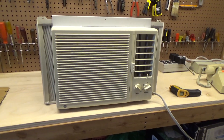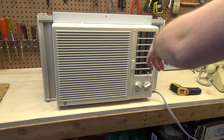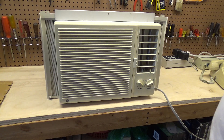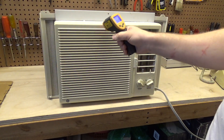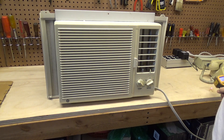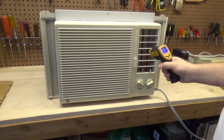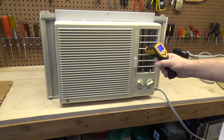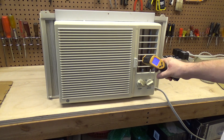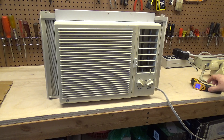Let's see what our temperature is — it feels nice and cold. Yeah, very, very cold. Going in, we've got about 64 to 67°F, and it's colder over there. I'll say it's like 63 to 65 going in, and we've got 40 coming out. So it's a good split — 35 at the bottom. It's working properly, about 34 to 36 somewhere in that range. Those things aren't a super accurate way to check the temperature, but it's got a good 20 to 30 degree split coming out, so that's fine.